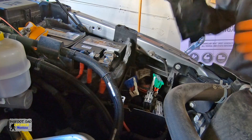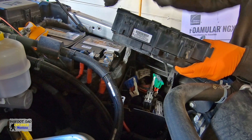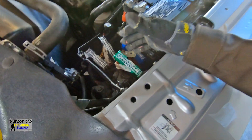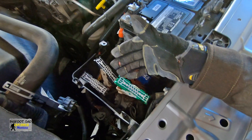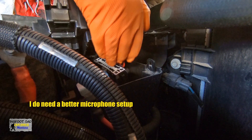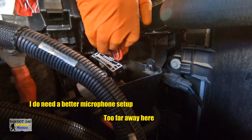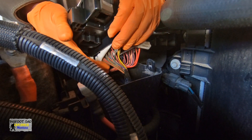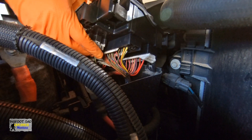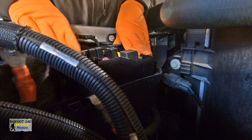Here's our old TIPM. If you're looking for the part number, it's on the back side of the TIPM — I carefully lifted it just enough from the casing to get that number. To put the new one in, all the plugs only go in one way, so there's only one way to do it. Make sure that's in, locking mechanism back up, pull on it to make sure everything's seated correctly, click the locking mechanism back up, and make sure that's seated.